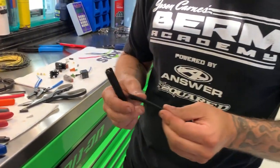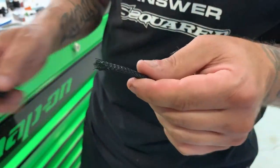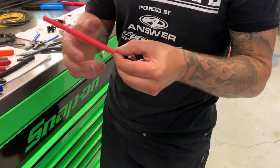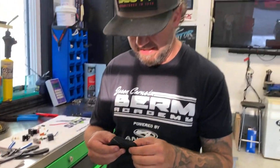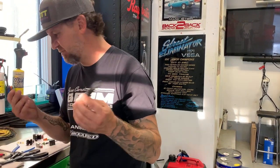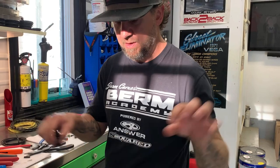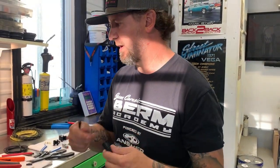Protective shielding for wiring — there are a couple of different styles. I like this thin nylon base stuff, it's super flexible. I'll often pull it over a harness to protect it, even slide a piece of shrink tube over the end and shrink it down to seal it all up. Some people like the split barrel stuff because you can apply it afterwards, but the only thing I don't like about that is it's almost like a cloth material and in a boat I think it would get wet. I'd rather use the stuff you slide on beforehand.